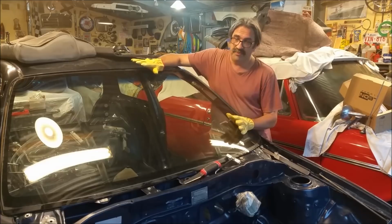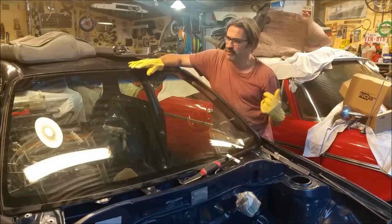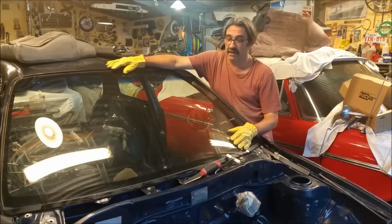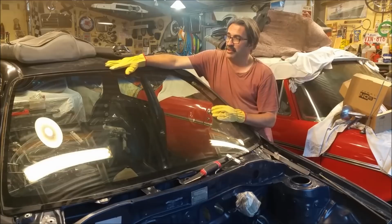Now, the Sigma was quite easy because we had a four-door and we could roll the windows down. And the front rear glass was bonded in with the mastic and a hot wire, which is easy because you can just cut through it and literally kick them out. You can sit in a passenger seat or whatever and just put your boots on the screen and push the things out. They're fairly easy, even though I cut that one out. This is urethane, which is a lot better in terms of you'll never get screen leaks with it, but it means taking the screens out is a bit more difficult.